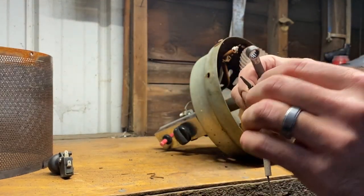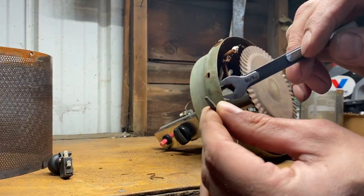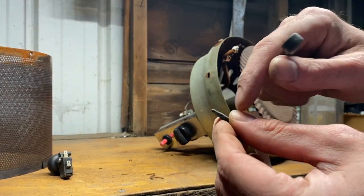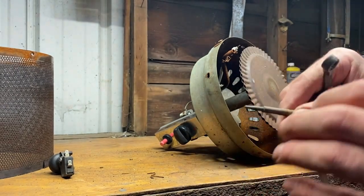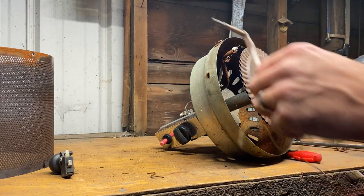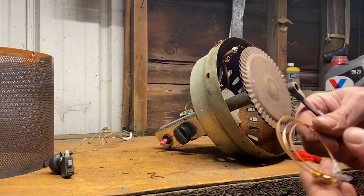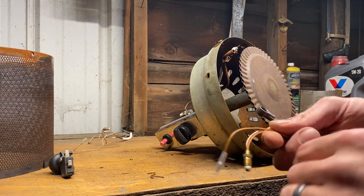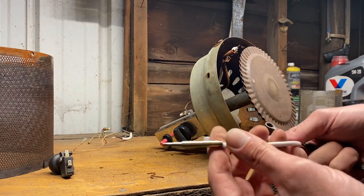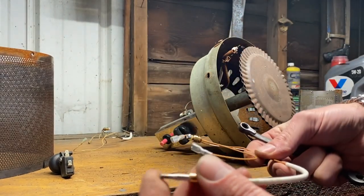I was reading online — usually when these fail, the tip has a tiny hairline crack. When the end of this gets cracked, it doesn't get a good reading on when the flame is on it, kind of like your flame sensor on a furnace. So if you've cleaned it, tried to save it, and it doesn't work, just buy this kit. They send you a brand new one — you can tell the difference, it's got a nice new end on it.